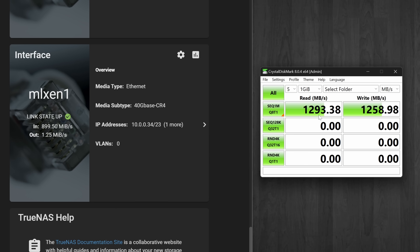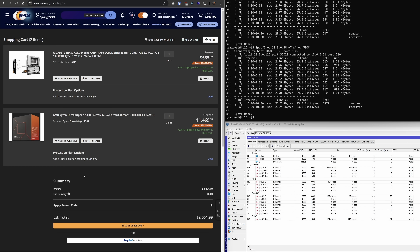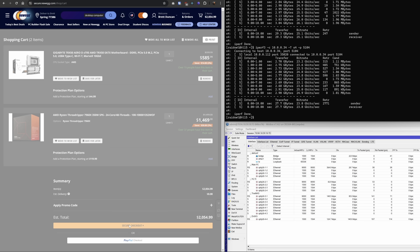Was this the outcome I was looking for? Obviously not — I wanted to get 100 gigabits per second from my workstation to my TrueNAS server, but that's not physically possible, and honestly it's not even worth it. We saw earlier that the max speed on actual file transfers was 10 gigabits per second. So clearly it wouldn't even make sense to purchase a Threadripper and a new motherboard and spend $2,000 just to get extra PCIe lanes to run benchmarks.